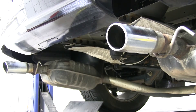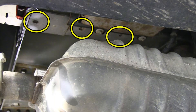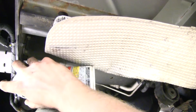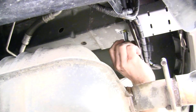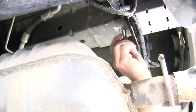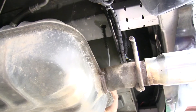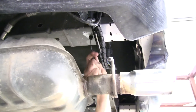We did a couple of tests with the hitch to make sure the heat shield was out of the way. Once we're satisfied with that, we'll go ahead and start cleaning out the weld nuts in the frame. There are three locations for weld nuts here, here, and here — identical on both sides of the car. We're going to spray down the holes with some lubricant and then run our hitch bolt in and out a few times to help clean them out. Since this is an older vehicle, chances are we'll also use a thread tap to really clean these out. To help clean up the threads, we'll be using a tube brush, part number 814092.